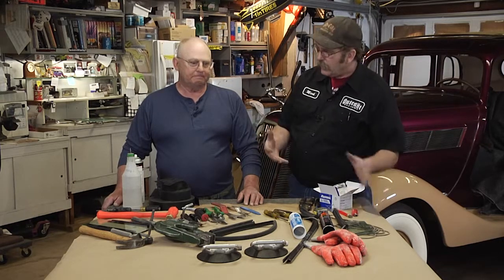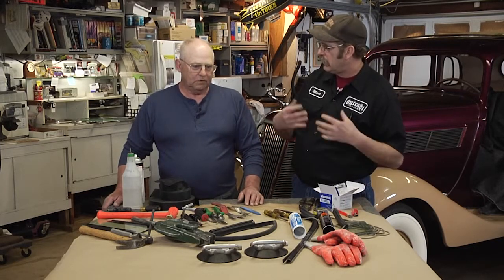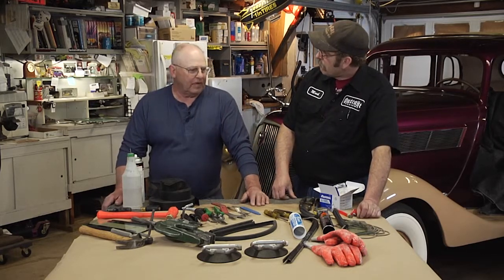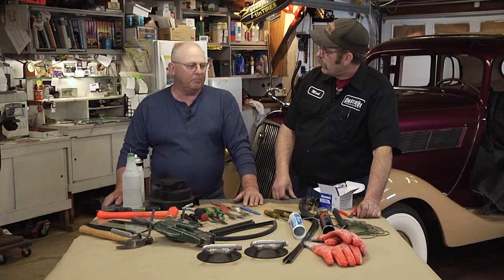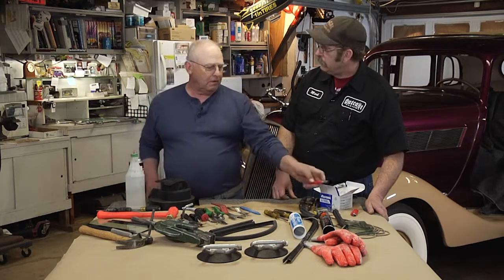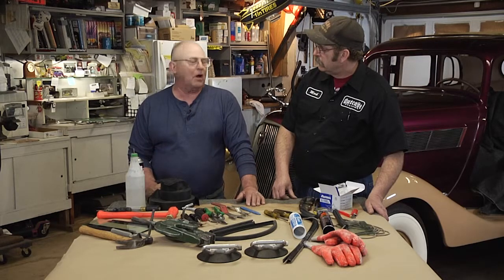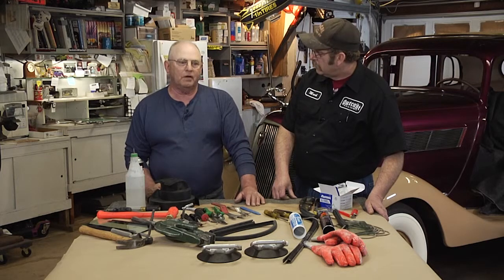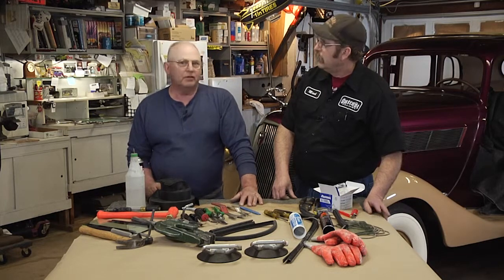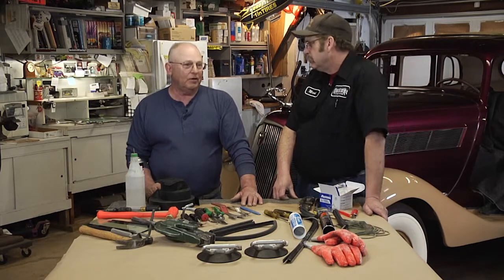You bet. Very good. And what kind of tools should a guy anticipate having to own in order to actually do a lot of glass cutting, both cutting and installation? Well, I guess it all depends upon how heavy you're going to get into it. The novice could probably get by with just a glass cutter, some alcohol, a straight edge, things like that. When you get into the bigger stuff where you want to polish edges and make a nice finish on the glass, then you're going to have to go to a big, powerful glass grinder that's driven by water and electricity. And that's not a cheap piece of equipment. No, they can run easily $2,000.